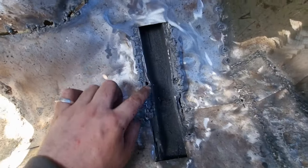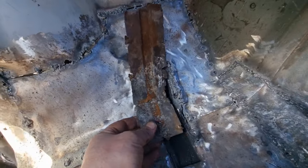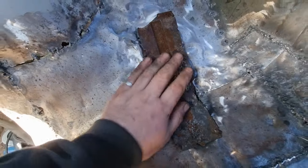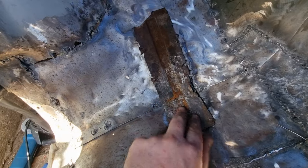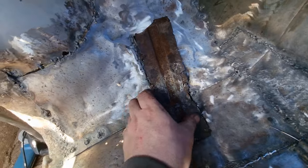There it is so far — the metal panel is in. I've even decided to do this: I've welded it all down the sides. I'm just going to clean this up because there's nothing actually wrong with it, it's solid. That will go in like that and then that will weld back into there. I'll clean it and brush treat it. These are just some of the welds so far to hold it in place, but I've butt welded it all the way around.